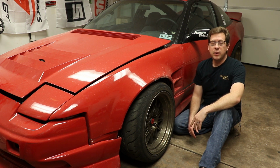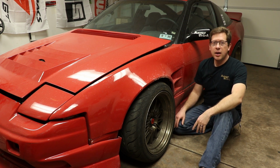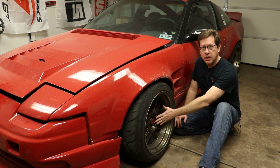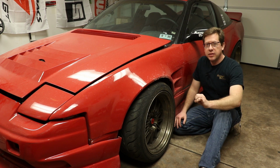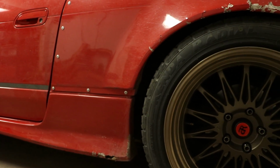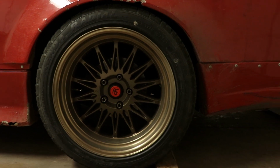After that, you're going to want to do a bolt check. I can't cover everything in detail for that, but at minimum, you're going to check all of your lug nuts, make sure that they are tight. You want to check your suspension arms, you want to check your brake calipers, your drive shaft, and your half shafts. Really, you should check this every event.